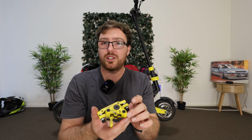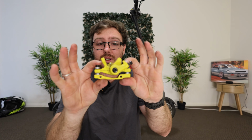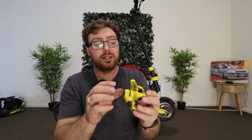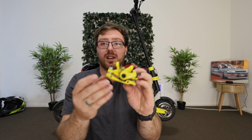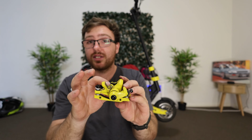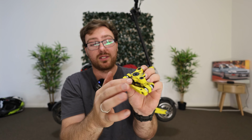So this is a really simple unit. Your brakes might look a little different to this one. It might have little fins at the top, or be red. Most of them are red or black, but for the structure of this video, we're going to be basing it around this one, which is off a Dragon Raptor, as you can see behind us there. But basically they all run the same. Some of them don't have this little pin at the top. Some of them actually just have magnets inside, so you literally put your little pad in there and it's just magnetized to the inside of here.